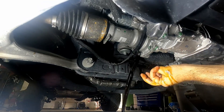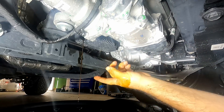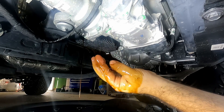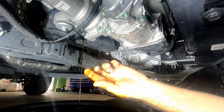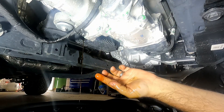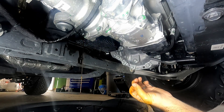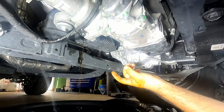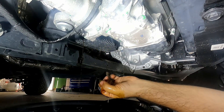That's a little hot - it comes out fast. It's been about 15 minutes since I shut the car off, so the oil is still pretty warm. It came shooting out of there. We'll let it drain for another 15 to 20 minutes to make sure everything gets out - it's a slow stream now but it's pretty steady.